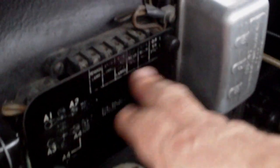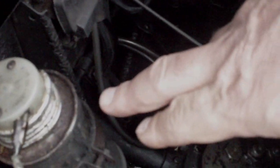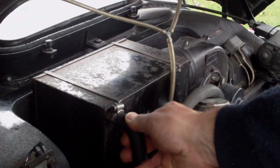Tell me all about this side of the engine. This is the current voltage regulator — basically it controls the electrical current to and from the engine. This is the fuse box, with a little fuse in there and a spare fuse in the bottom. That's the brake fluid reservoir. The wires coming off the reservoir go to a light on the dashboard which indicates whether it's getting empty. I just recently changed this hose — it was perished and I've put a new one on and bled the heating system so it's now okay.